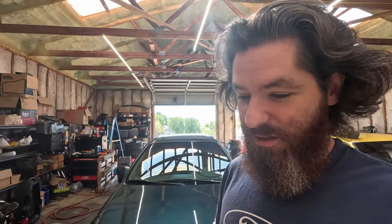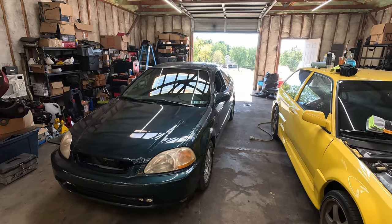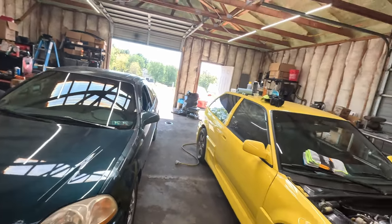What's up, we're back at it again with another video. Big thanks for all the love on the last video — that thing's been popping. We are going to the dyno again with Christian's car. I've brought you guys a few videos on this one covering putting the motor together, first start, and driving. The car's been driven about 800 to 1,000 miles of break-in. It was on a six-pound gate spring, now it's on an eight-pound gate spring — it slowly creeps to ten, probably because there's not much timing in it.